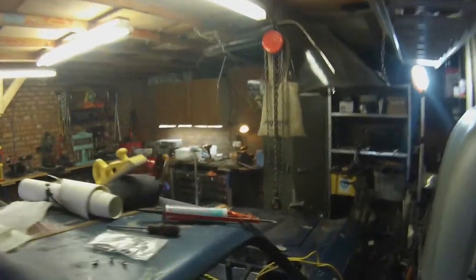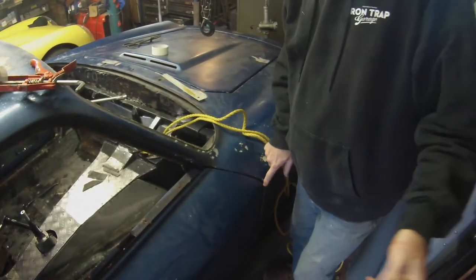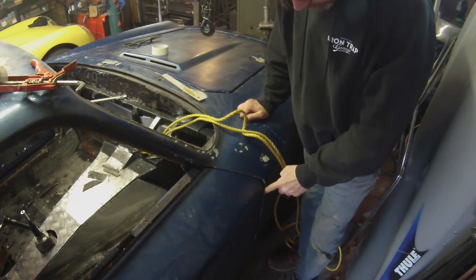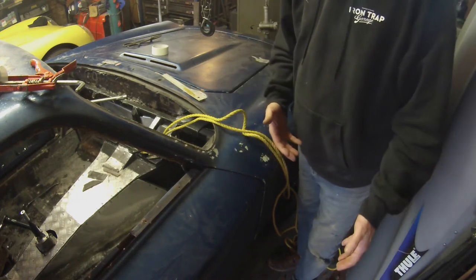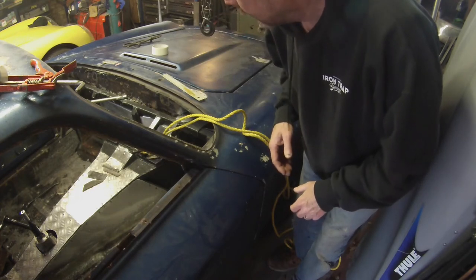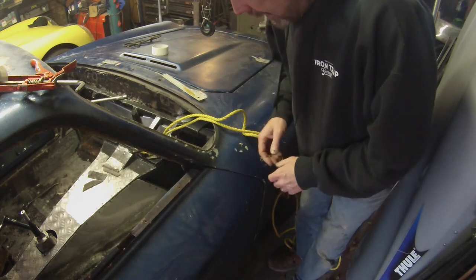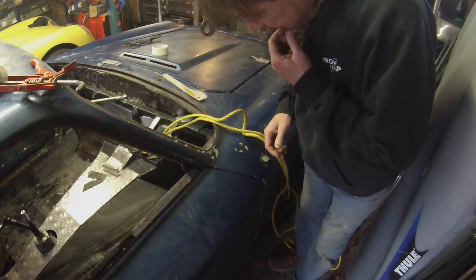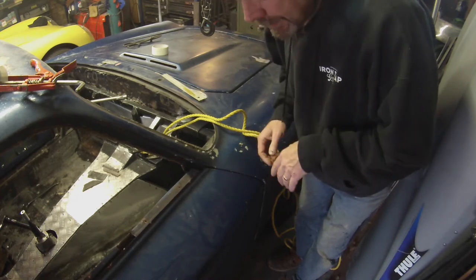You can see where the body has moved on the other side. The door is now in by about a quarter of an inch, which obviously means this door hinge also needs adjusting so the door comes outwards. Clearly there's a balance to be struck between the two doors, so that's something I'll have to fiddle with. Anyway, that was a little moment of inspiration I had earlier this morning to solve the passenger door fitment issue - just needs some finessing to get it right on both sides.